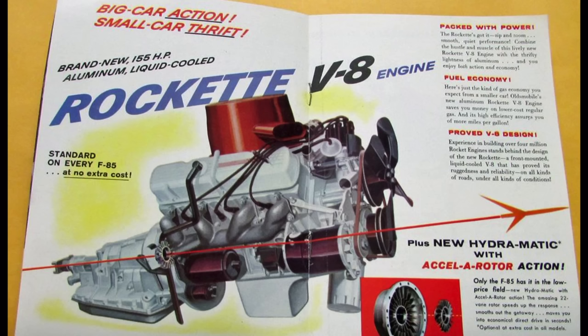There were two versions of the Rotohydromatic: the Model 5 and the more heavy-duty Model 10. This F85 has the lighter weight Model 5 transmission. Some of the full-size cars, like the Oldsmobiles from 1961 through the mid-60s, as well as short-wheelbase Pontiacs, use the Model 10 transmission. So be on the lookout if you want one of those short-wheelbase Catalinas and Grand Prixs from Pontiac in the early 1960s, and check to make sure you don't have this Rotohydromatic or that it's been recently serviced.